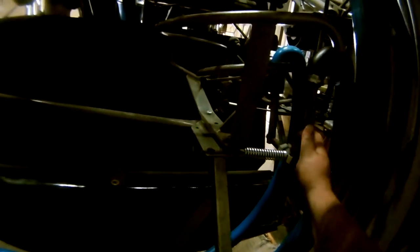Now, when I got done, there was not a single kicker. The top of the lift rods was adjusted. The bottom lift rods adjusted. I didn't even touch the ball spin eliminator. I didn't need to bother with it because all the balls were coming back, getting down there, and going up like they were supposed to. So, let's go through and fix them again today.